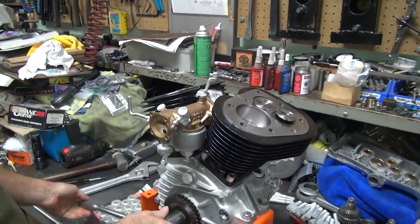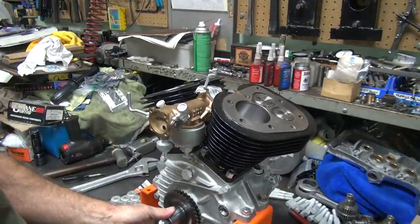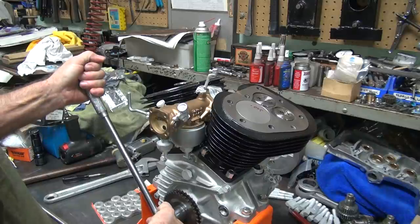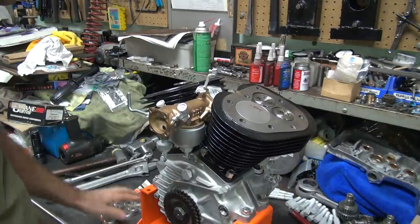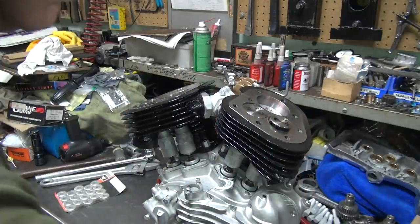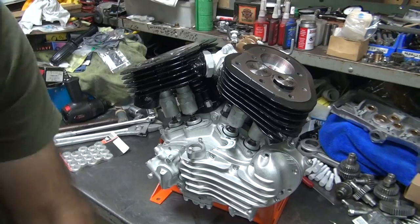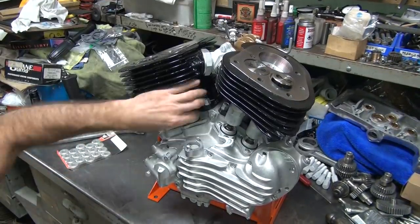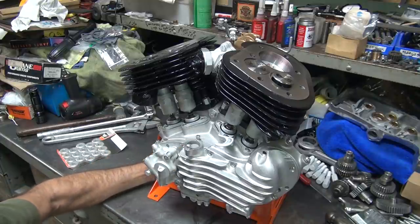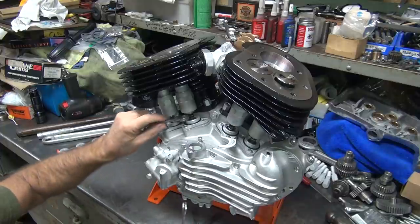Now I'm going to turn the motor over and go adjust the other valves — we're going backwards. The intake valve's all open over there now. These two valves just closed — that's top dead center coming up on the compression stroke. It's all the way up — top dead center. We're going to do the 6 by 8 again. There's lots of clearance on that lifter. The front intake, which had the biggest adjuster on it, is the one that has the least amount of clearance. That's good planning.